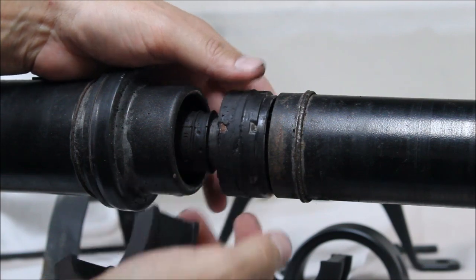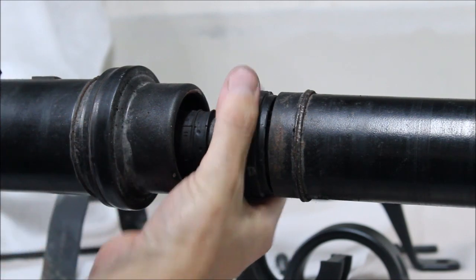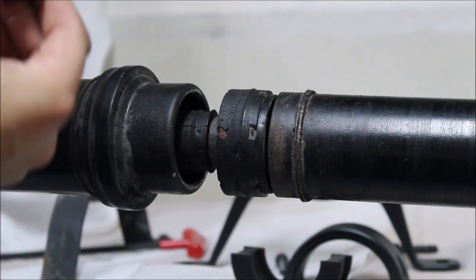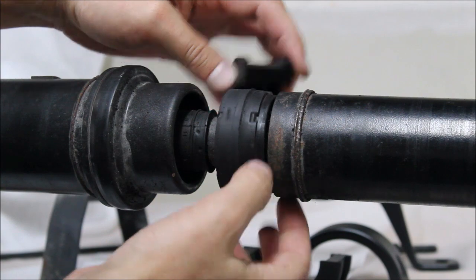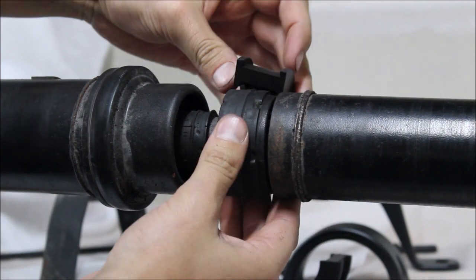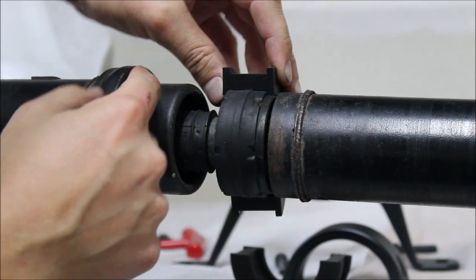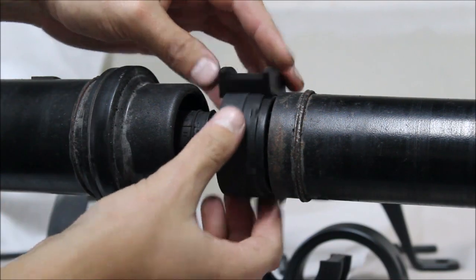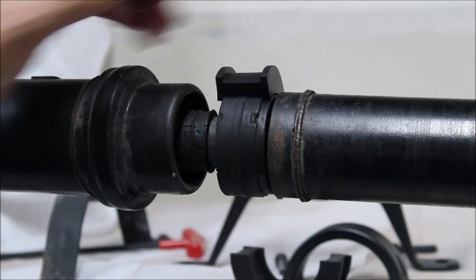I've actually designed these bushings to go on top of this base rubber layer. If you remove all that rubber all the way down to the middle, the bushing will actually be loose — so don't do that. The way these line up: there's a lip on the right side with a flexible overhang of rubber, and the bushing should go right down into that lip. The other side should hang off the left, which is the rear of the vehicle. They'll just clamp around there nicely, and then we'll come to the car and attach it.